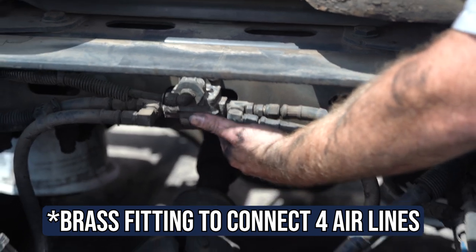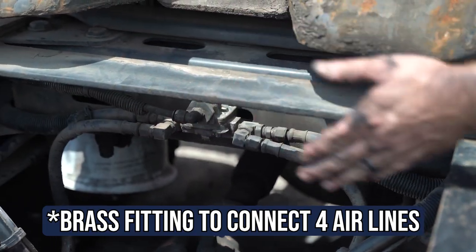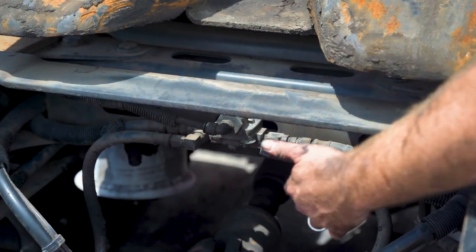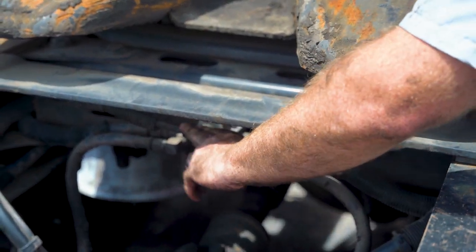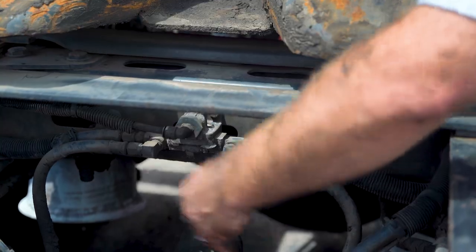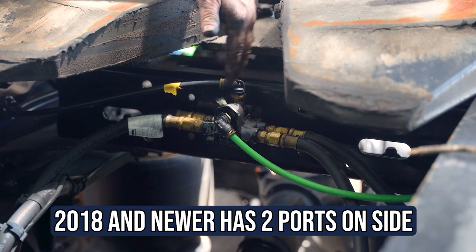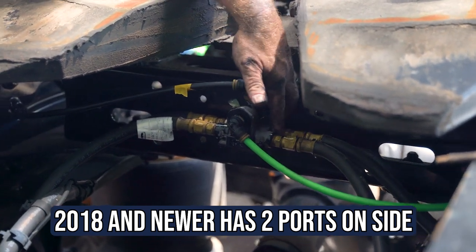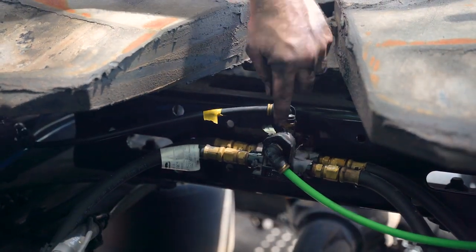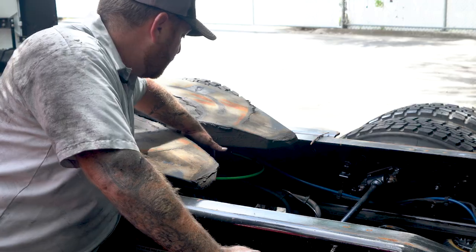Here's a picture of the other style I was telling you about — same exact valve. The only difference is that they put brass fittings to accommodate the brake chamber for the rear axle. So you'll have four total rubber airlines: two on the left, two on the right, with an air supply in the front and one on top — exactly the same. And here's the newer style, 2018 and newer: you'll see there are two ports now instead of the brass fitting tee — two on this side and two on the other side. The air on top and air fitting on the front are still the same locations. The only difference is two ports instead of one on each side.